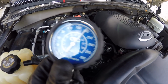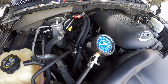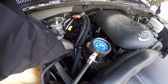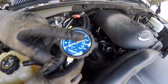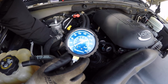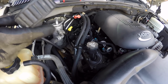All right, number one, we're at 180. I know a lot of you guys who watch my channel do work on cars, but for anybody who doesn't, as far as cranking this thing over, you're pretty much just cranking this till it doesn't go up anymore. I know a lot of people say give it 7 cranks or 5 cranks and stop. You're gonna kill the starter motor. You want to crank this until the needle isn't going up anymore, because the engine's gonna be building compression. If you just crank it like 3 times, it's gonna stop somewhere down low, and you're not gonna get an accurate reading. So once you see the needle is pretty much not moving anymore, that's pretty much where you're at compression wise. The other thing is, with all the plugs out, there's no load on the starter, so it's pretty much just free spinning the motor.